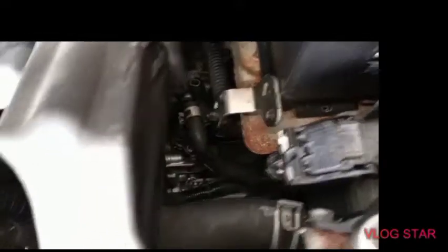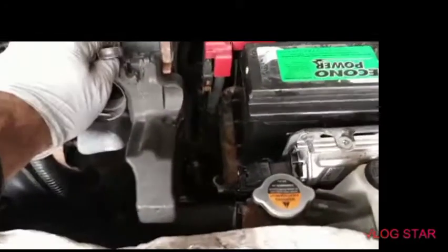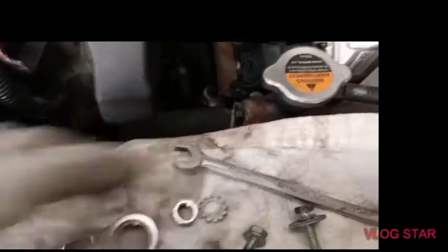I'm going to show you how to take it out. You can see this bolt at the top — it's 14mm. I already removed it using my wrench. You can take the battery out and remove the air box to make more room, but I'm a technician so I'm doing a shortcut. This is a 14mm bolt — make sure you keep that washer.